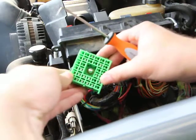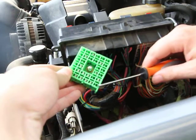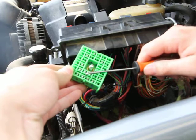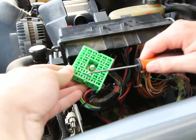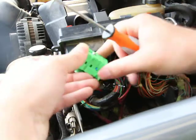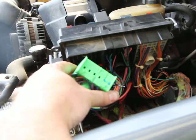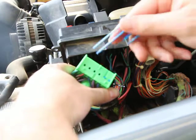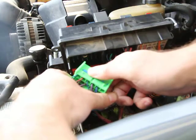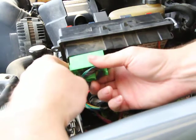So A3 — you can see the locks on top. You probably won't be able to see it in the video, but you can see the locks on top. Here's a lock right there. You want to make sure, 1, 2, 3 — you want to make sure that the lock goes into the open side of the terminal. So it looks all good there. Then we'll need to put our lock back in. That locks the pins into the actual plastic housing, or the front light pack housing. Then we'll rotate and put it back up into the truck.